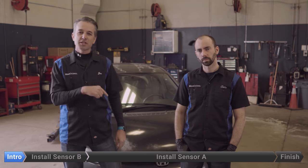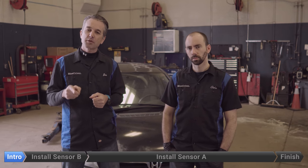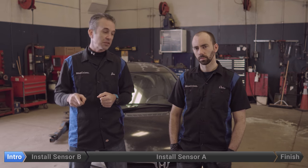Blue Driver Nation, how you doing? Jim and Chris back at you with a 2007 Honda Civic. Kind of an oddball repair here, but it happens a lot on this car — it's your transmission fluid pressure switches. There's one on the top of the engine and one on the bottom. If you have your tranny light on or your transmission isn't shifting, you pulled a P0745, a P0856, or a P0858, it very well could be these transmission fluid pressure switches.